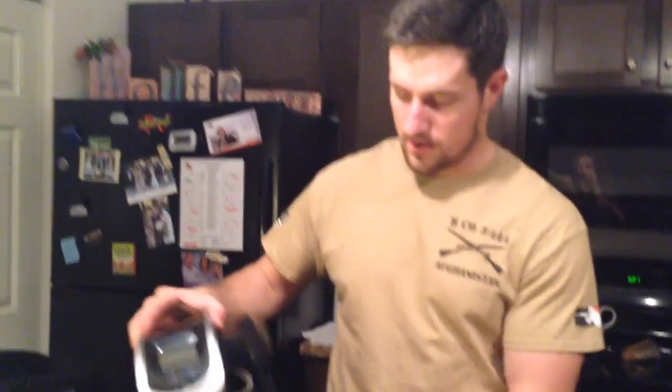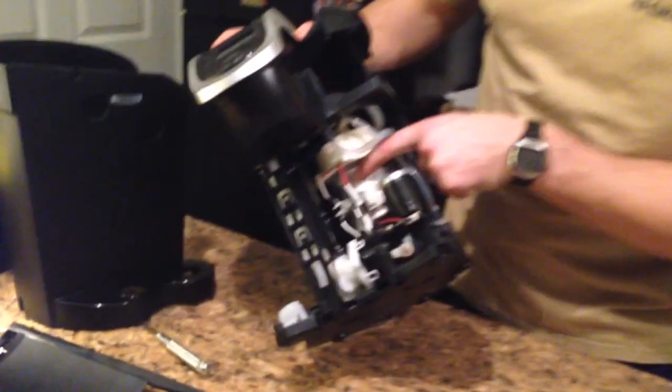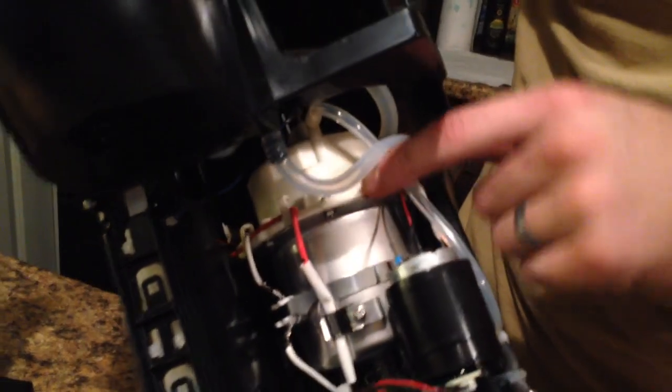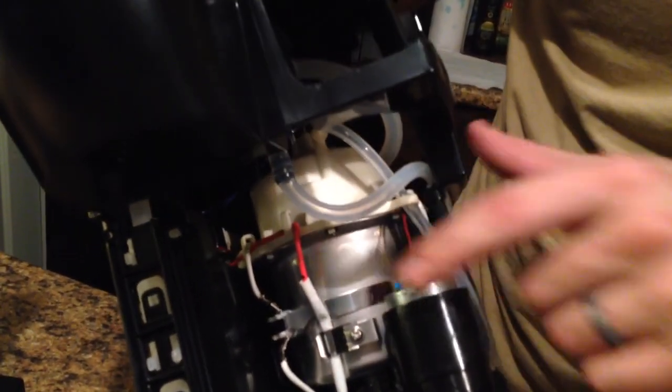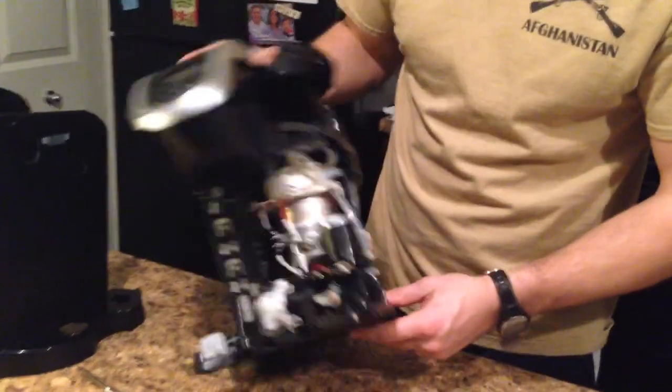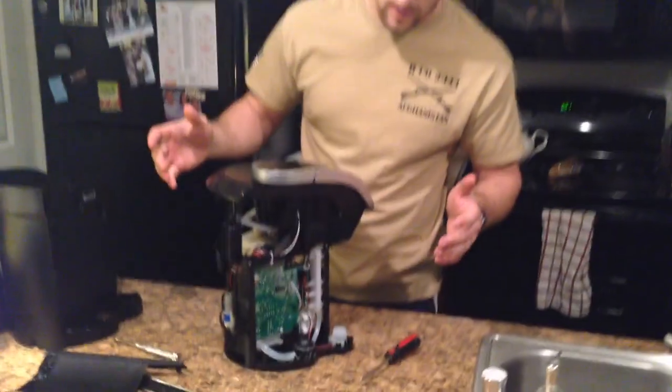And if you're having water leakage from the bottom and you're not really sure where it came from, if you're living in a cold area, chances are this metal froze and it's separated from this top cover right here. And since it's separated, whenever it starts to boil and do work on that water, it'll actually spill out of here and it'll leak from the bottom and all those areas. So there you have it. There's the disassembly of it.